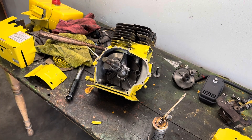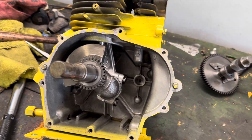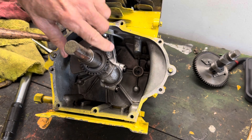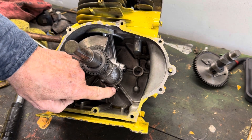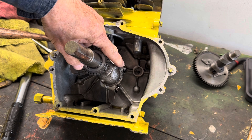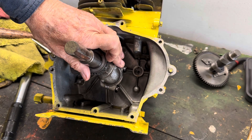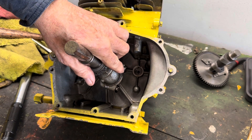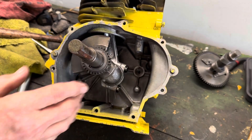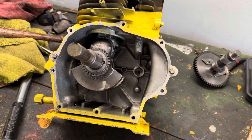I want you to get a closer look at this. I know you can't see a whole lot, and I want to get really close up to show you what I'm talking about. One of these days I'm going to get myself a cameraman — anybody out there want to donate their time? There is a lock tab right here and right here, and this is what we bent over. You'll also see an extra one straight out here — that is in case your bolt after you've torqued it down ends up in a different position. You can use that extra tab and bend it over as well. So there we are: we have the end cap on, torqued at 200 inch pounds, and the bracket plate secured in place.